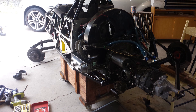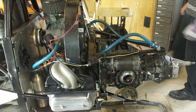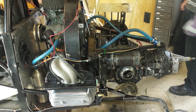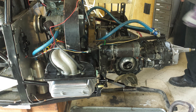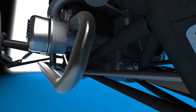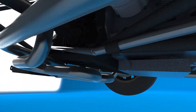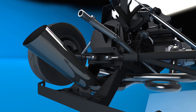I used a known exhaust length from the broken car that I bought. I could have determined another length from theory, but in practice a lot of development would have been required on the dyno to verify it. I decided it would be more suitable to use a known starting point. My car therefore has quite long exhaust runners, so would scavenge the exhaust better at lower RPM since it will take longer for the reverse wave to return.